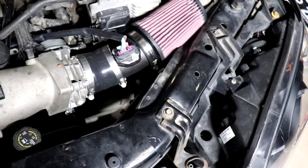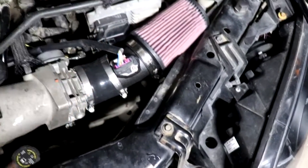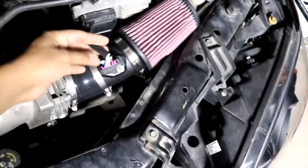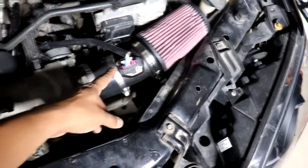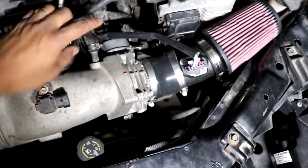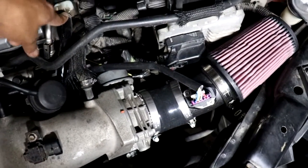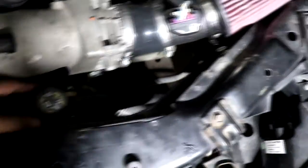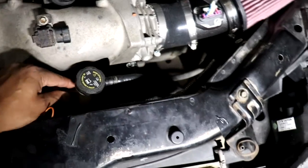The 45-degree elbow they sent was a little too long, but I got it cut and set so it's not an obstruction and the hood closes properly. The MAF sensor extension harness relocates the MAF sensor from the passenger side to the driver's side. The brake booster line attaches to the supercharger, and the EVAP line that was going to the purge solenoid is now routed with a hose to the throttle body. There's also a heat exchanger here with coolant fill access.